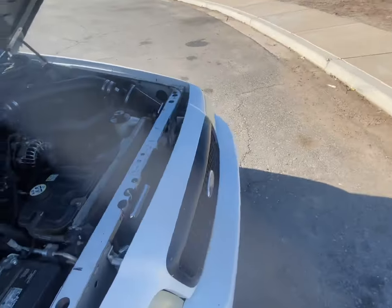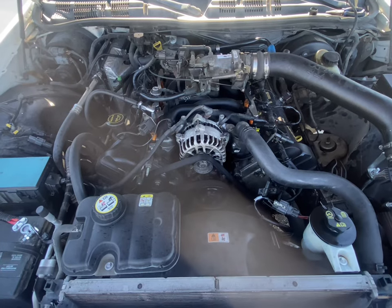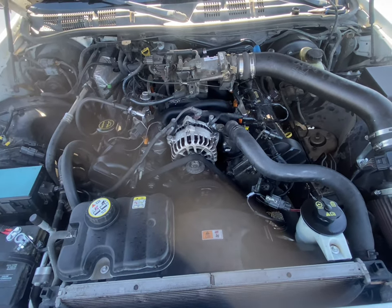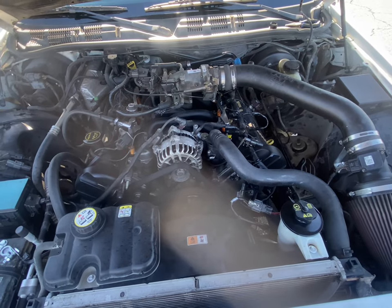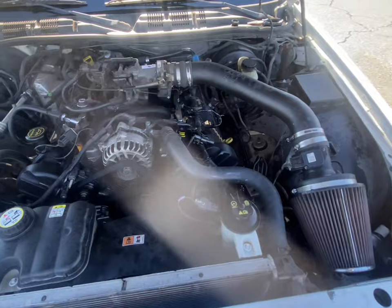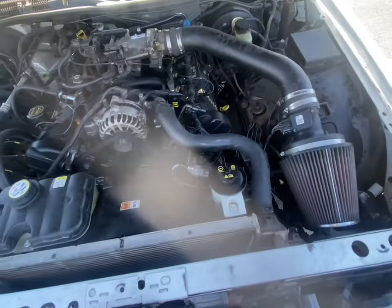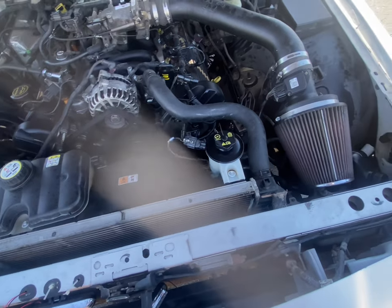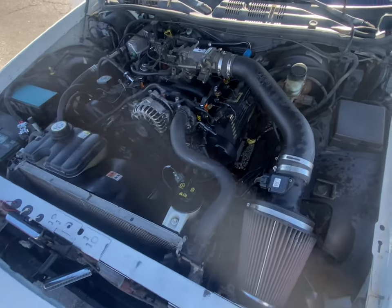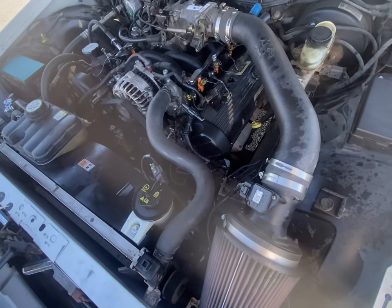As for the misfiring issue - it's crazy but I think I fixed it. It doesn't misfire the whole time it's running anymore, it's like a misfire that happens every now and then, like every blue moon. I got a test light out and checked everything - everything's getting the right amount of electricity. This one injector at first wasn't getting power, but I kept wiggling my test light around in there and all of a sudden it started getting better. Then while the car was running I unplugged the ignition coil and nothing changed, so I dug around in the trunk for extra parts.